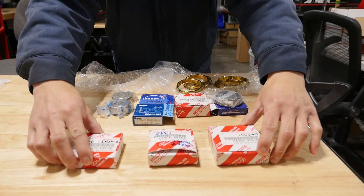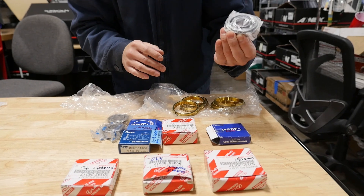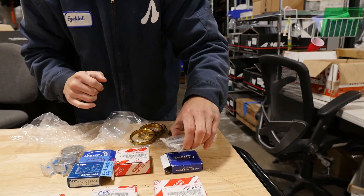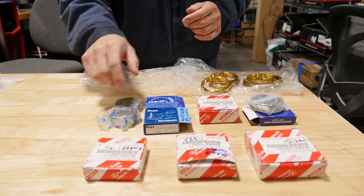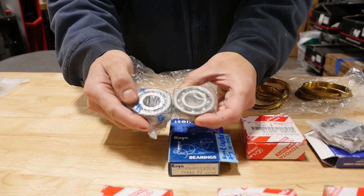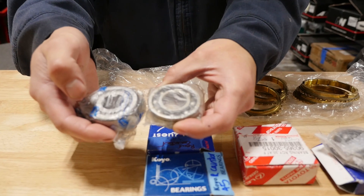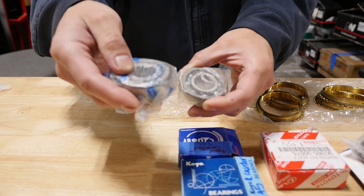A lot of these bearings are actually discontinued now. I do not have a front countershaft bearing that's OEM Toyota anymore. The old one used to be cylindrical rollers; the new aftermarket one is just a ball bearing. Same thing — the OEM style rear countershaft bearings are no longer available. The OEM style has inner and outer races with cylindrical bearings, while the new aftermarket one is all ball bearings. I'm okay with the new style, but even hard parts like bearings are getting discontinued.